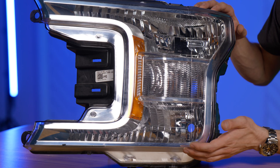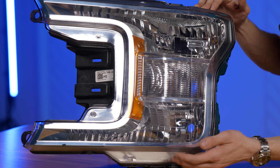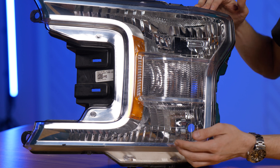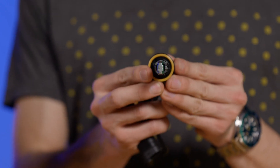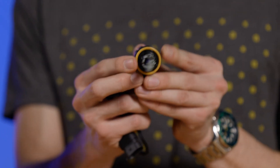If you're not already familiar, this is a reflector housing. You can see it's got these mirrored facets going outwards, and you want those LED chips to be aligned so they're facing directly out to the left and right to reflect off of those facets properly. On the Morimoto two-stroke 3.0, the bulb needs to be perfectly up and down so that the chips are facing to the left and right.